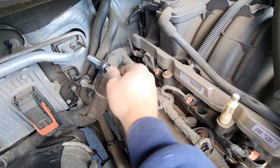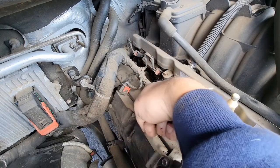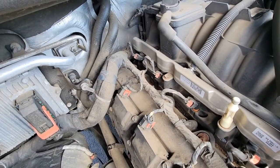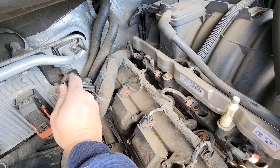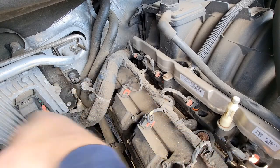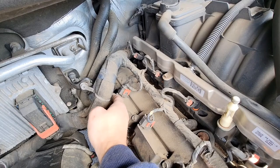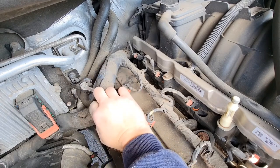All the way in the back - the bad one. I just took this off, let me tell you what to do. The first 10mm, which is right here in the coil pack - which is actually behind here, you can't even see it because it's so far back - you want to use an extension that goes right through here and you can sit around that clip and behind the wiring harness, that'll give you an angle to get that one. To get the back one you have to use a very small quarter-inch ratchet with a very short socket all the way back there to break it loose, and then in order to actually take it out you need to take your ratchet off, pull the wiring harness up, and slide your hand underneath there and then you can manually finish it the rest of the way.